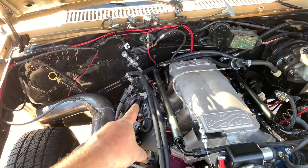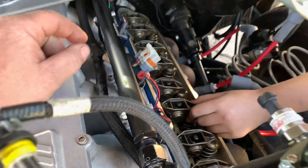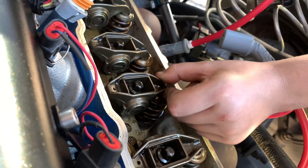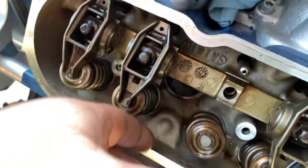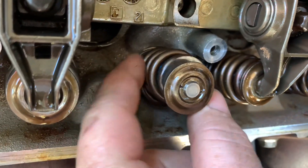We had checked this side for tightness and broken springs and bent push rods. We ended up pulling this one this morning, and that's no bueno. So we're going to pull it apart and see what's going on. We went out — well, we had a friend go out — we bought new spark plugs, new wires, did everything, good to go.